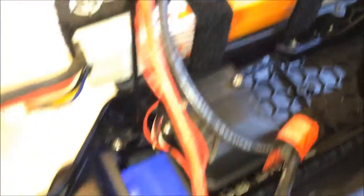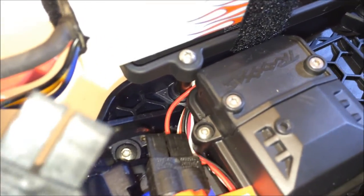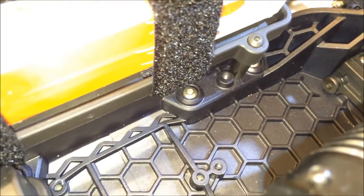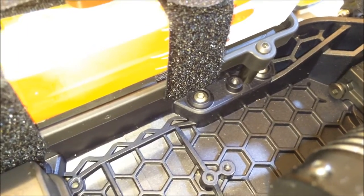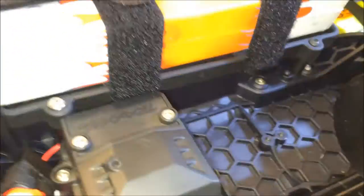Everyone else should be able to mount these batteries right on top of the Nerf bars. I took a spacer, mounted it to where one of the Nerf bars bolts — front hole — and in the back I drilled a pilot hole, used a spacer, and put it right in there. It spaces it out perfectly so that the straps can come through underneath. It's bolted to the chassis on one side, and on the other side it comes around the Nerf bar and straps to it.